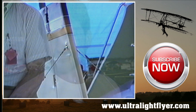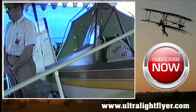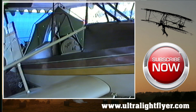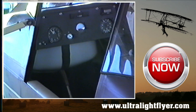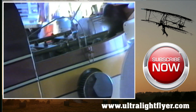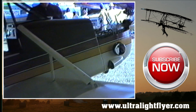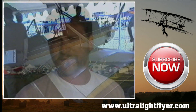With a 503, what kind of performance would I get? My airplane, which is modified from Bobby Baker's original intent — takeoff roll, depending on weight, is between 250 and 300 feet. Landing roll is generally about 400 feet. Normal cruise is 85 miles an hour, approach is 50 to 55, and stall occurs at about 38.